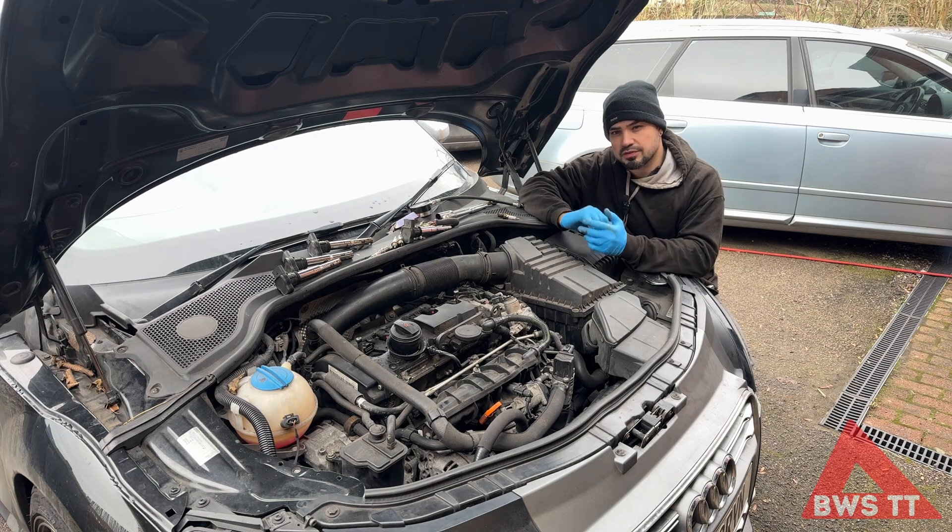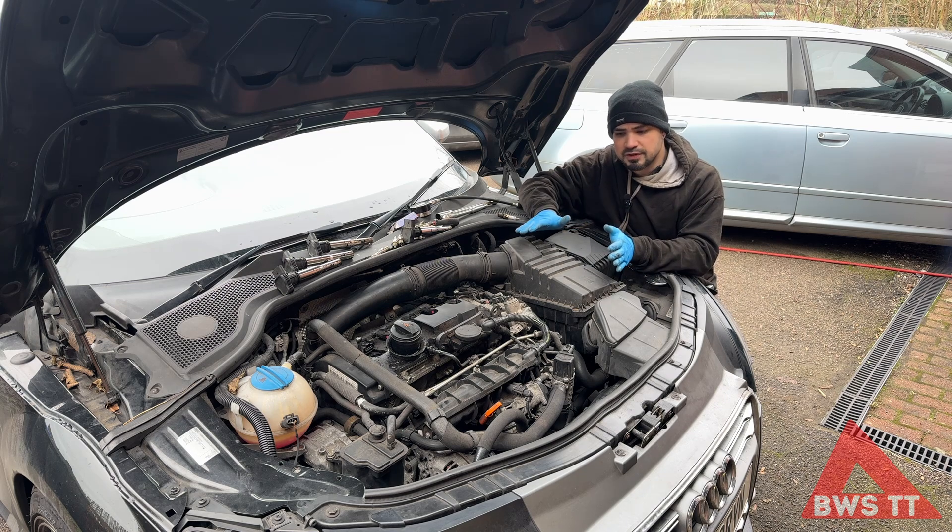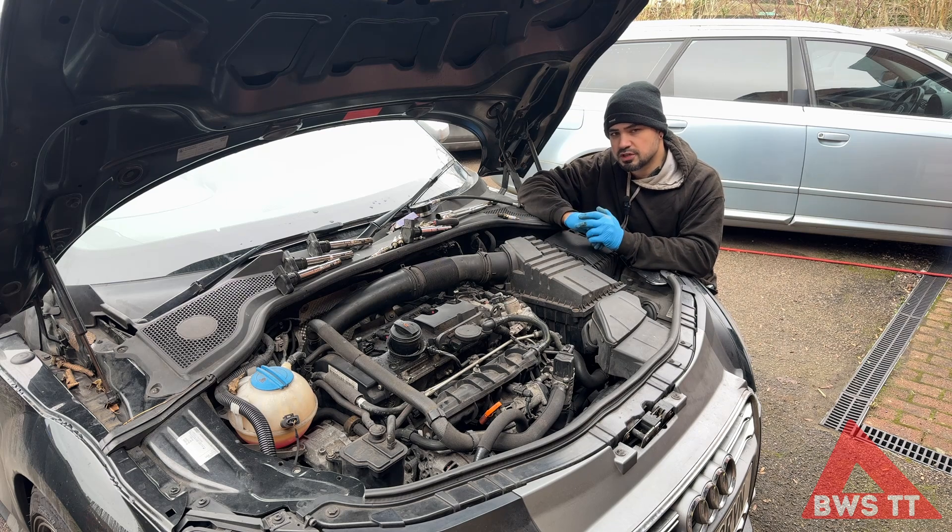That puts me on the lower end of healthy, slightly off the scale of what is ideal on these. However, I'm within 10% across all four cylinders and I'm well above the tolerance for these, which I think is in the 140-something PSI range. So yeah, still a perfectly fine engine, and at 156,000 miles those results do not surprise me.